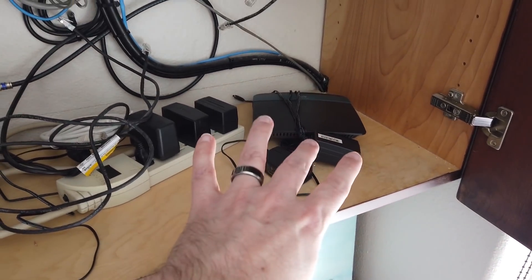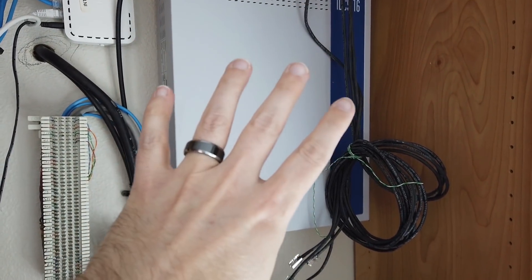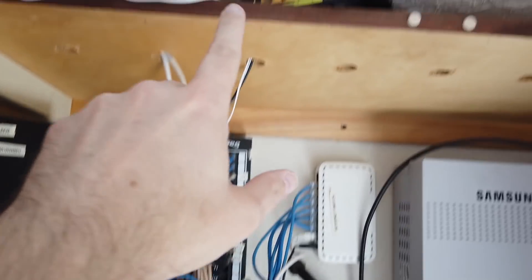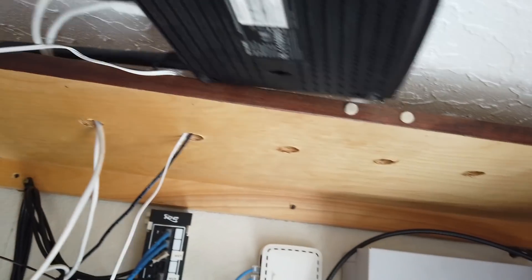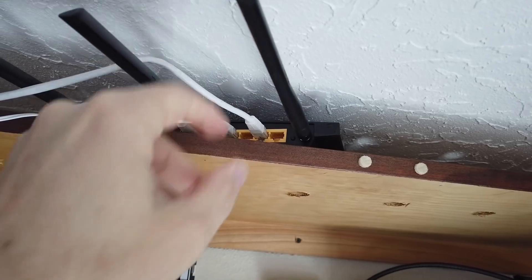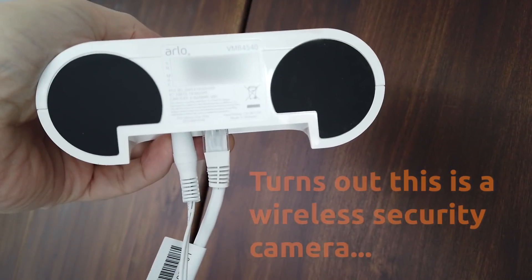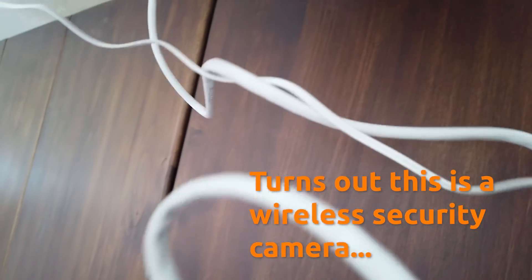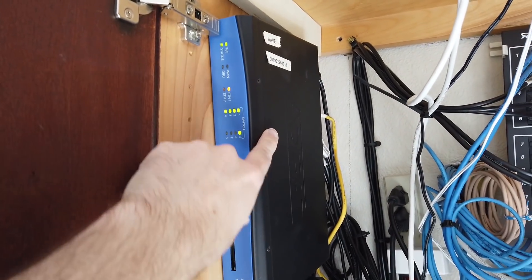Here's what I'm looking at. We've got some old equipment here — this is an old Samsung phone system that is not in use. I'm going to get rid of it. Here is where their internet comes in, the Wave Broadband, that goes up into this TP-Link router/Wi-Fi combo unit, which I suspect is double-NATted. That also goes over here to this Arlo device — I'm not sure what it's used for so we'll just leave it in place just in case.